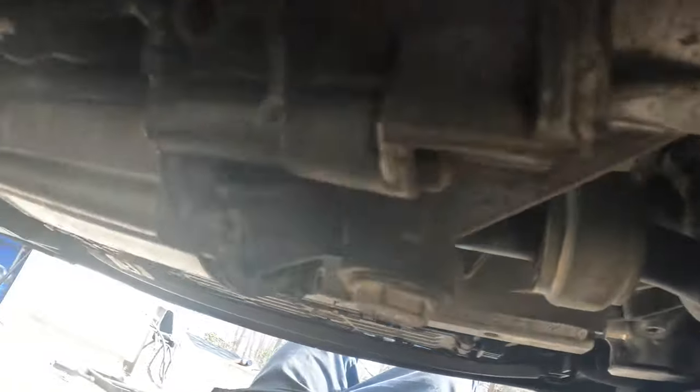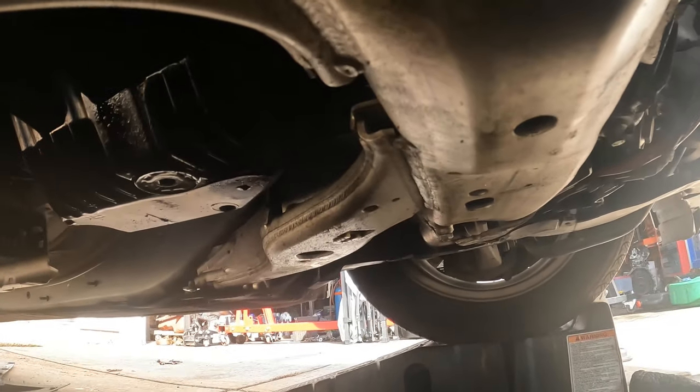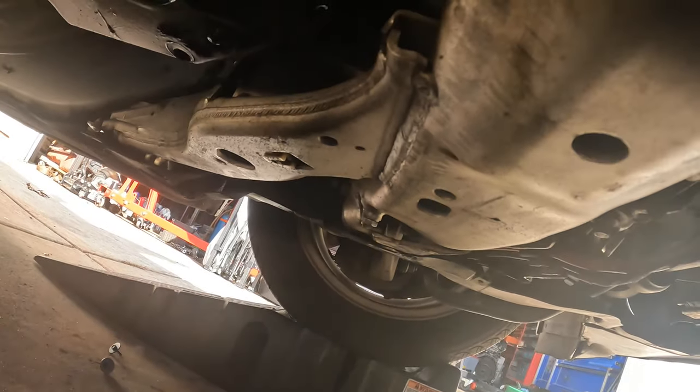Once we get the motor mount out we can go in between there and get those last two or three bolts behind the motor mount. The motor mount bolts I think are 13 millimeters — pull them out and the motor mounts are ready to come out too. I'm going to do both sides. The passenger side is a little different because of the turbo. Looks like she's got a little bit of a turbo leak on the oil line coming in from the bottom, but it's not too bad — the oil pan is the biggest issue right now.